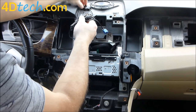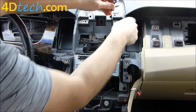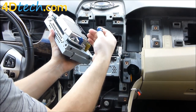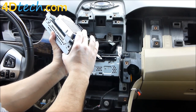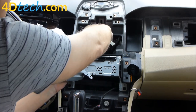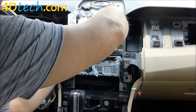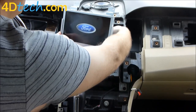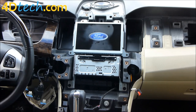The top of the antenna — where it says GPS — must face up. We'll tuck the antenna wire back into the opening. Now we'll install the SYNC 3 screen, connect that antenna wire, plug in the USB cable into the black port, then plug in the main connector — make sure the lever is all the way towards us, push it in, and push the lever until it clicks to lock it in. We'll set this in the opening where the old screen came out and replace the four screws we took out earlier.